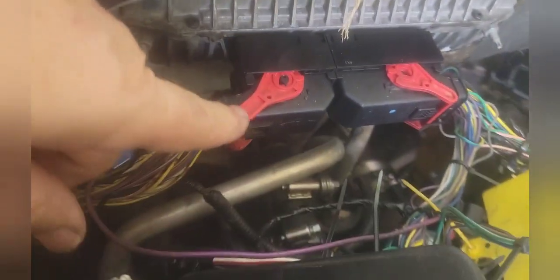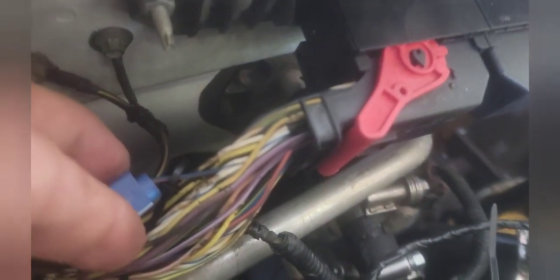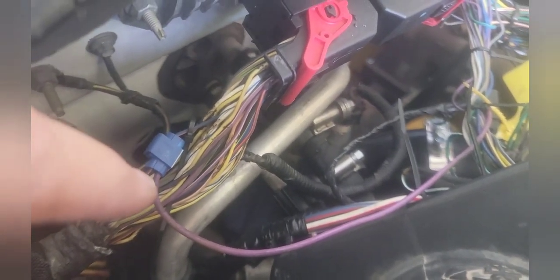This purple wire is my wire, and it's spliced in back here to this unit on the left side. There is a wire down there that is blue and orange — blue and orange — on pin number 12. I spliced it in. I'm going to make a more secure union than that, but this is just to test it to make sure I've got everything right.